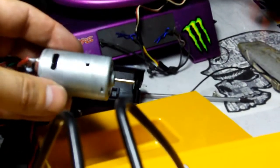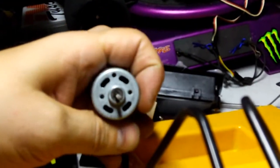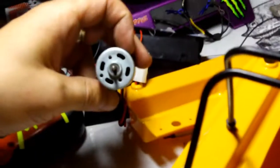The 380 brushed motor has been taken out. When you take it out you get a greeny-cream coloured thing that goes around there — that's a little bushing that goes between your motor and your jet drive. If it's stuck on the end of your motor, take it off and put it back on the jet drive side. If you don't put that on, your motor doesn't sit exactly straight and you get a lot of vibration and heat. It's a little bit bigger than the motor but you've got to put it back on.